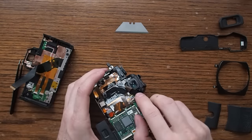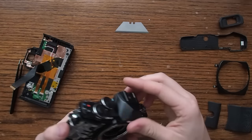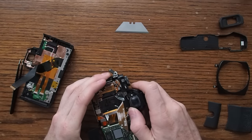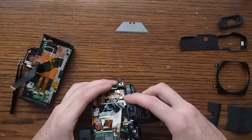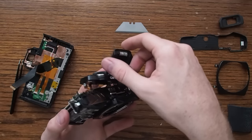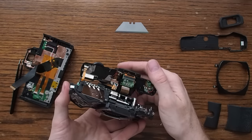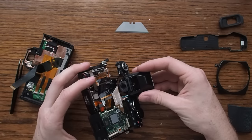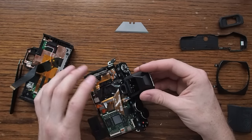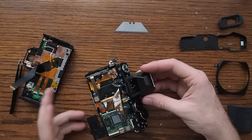In addition, if you want to do that, you also need to flip another one of these tiny ribbon connectors right here — this one's a little bit tricky to get to. There's a total of four ribbon connectors through here. I found I had to remove this top one, so being extra careful with this section because there are some cables inside, you can work it free. Pulling this off can definitely be useful if you need to get any access to the mode dials and the circuitry for the dials. You can't completely remove it unless you find a way to detach these cables right here which connect the flash to the camera body, and they don't have a simple ribbon connector — they're actually soldered on there.